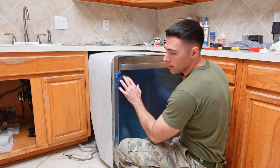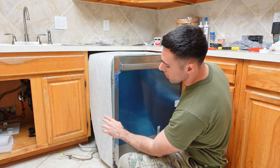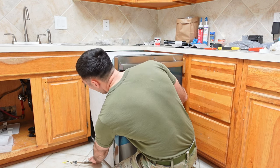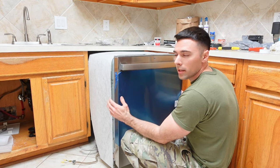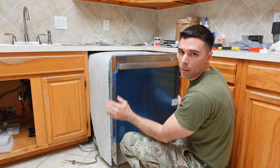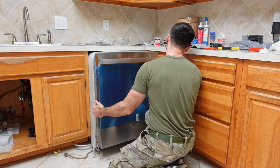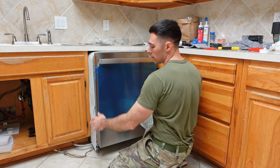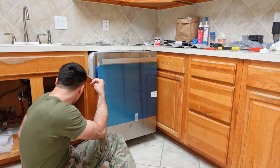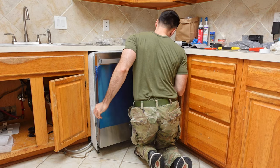Next step is to push the dishwasher into the opening, but don't go all the way in — only push until you have about six inches of the dishwasher still exposed. Be aware that you still need to access your water and power lines, so have those ready. Also be aware of your drain line and make sure you're not kinking it in the process. Make sure you have your insulation on top, because the last thing you want is to get it seated and then realize you forgot to put the insulation back on. Push it in using the sides, not the top. That's about six inches — I can still access my lines and there are no kinks in my drain line.